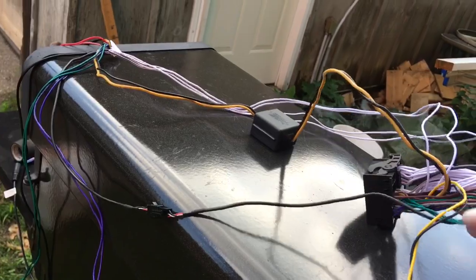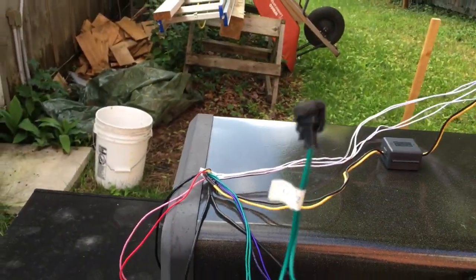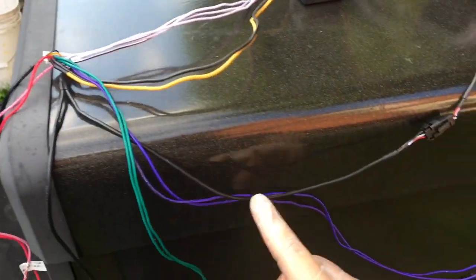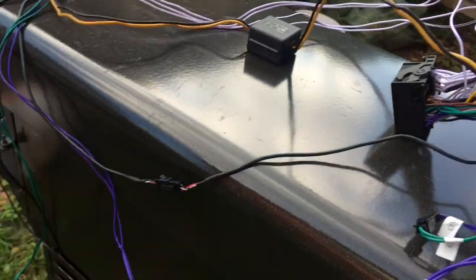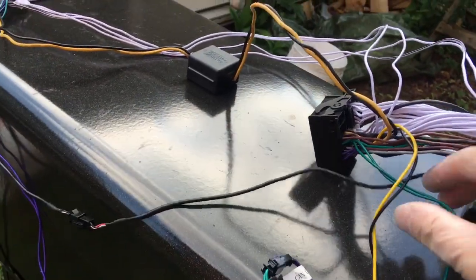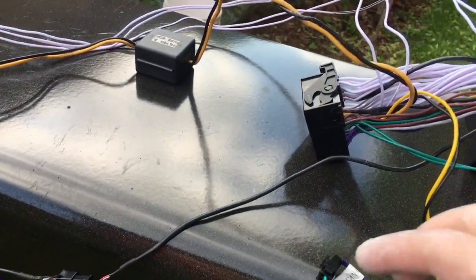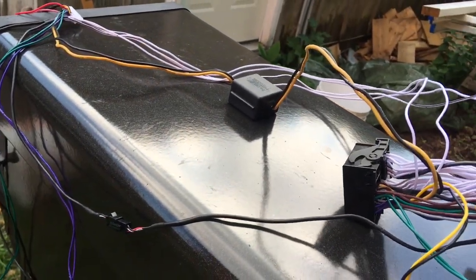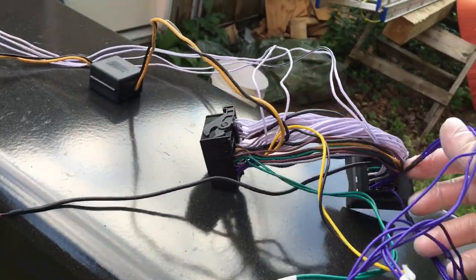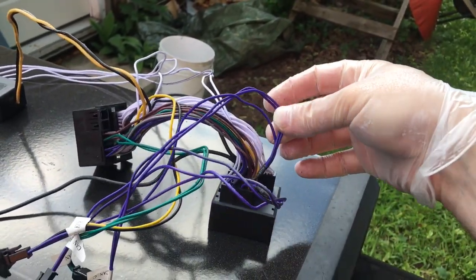The other thing I was trying to figure out is what's going on with all these different CAN wires. From the top there's a green wire called CAN 2 that goes to nothing, and then a purple wire called CAN 1. At the bottom, from the iDrive side it's got CAN A, and from the car side one of these is CAN high.